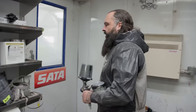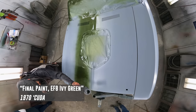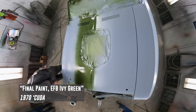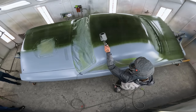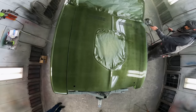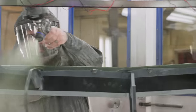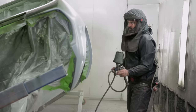You see the hat removal — the overdramatic hat removal — all part of the drama, right? He's in character now. This is funny to me. So when it comes to this color, very transparent color, I do five coats of color and then two drop coats to make sure the metallic is laid out properly. That usually takes me four to five hours if we haven't had any problems throughout. There were no issues on this car.